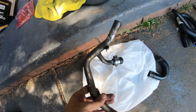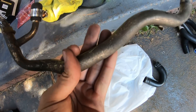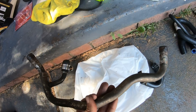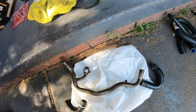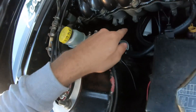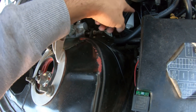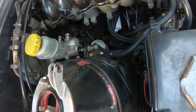This is the factory coolant line that goes to the two ports on the side of the block. This is not going to work anymore because the 90-degree fittings on the oil sandwich plate just take up too much room. So now we're going to have to go to the shops tomorrow and hopefully custom make a coolant hose from front of the port to the back of the port — make it work with some joiners.